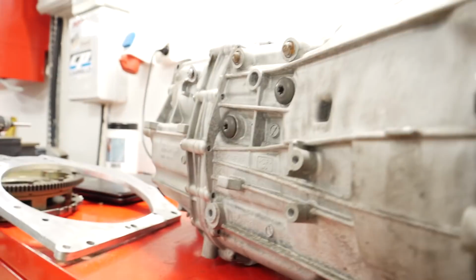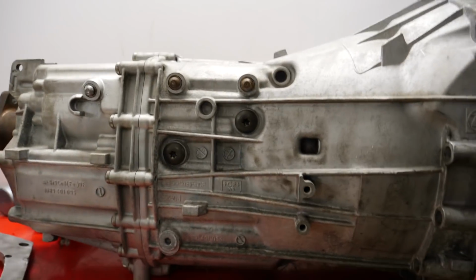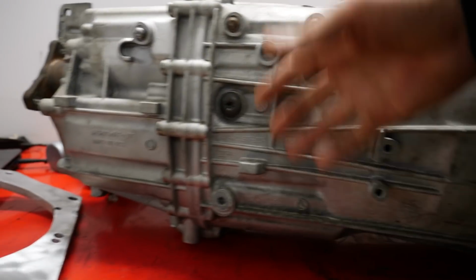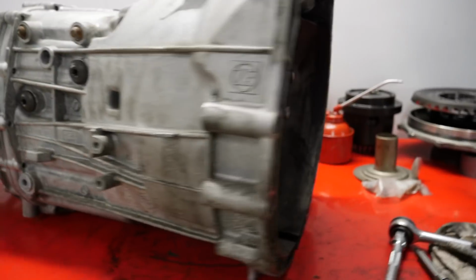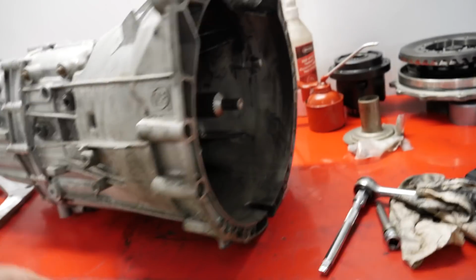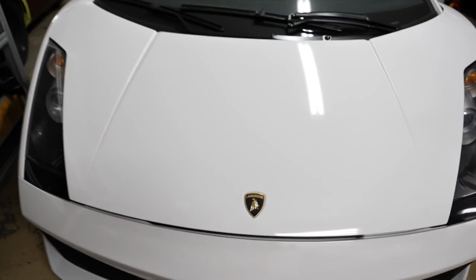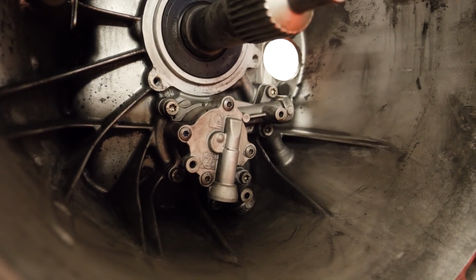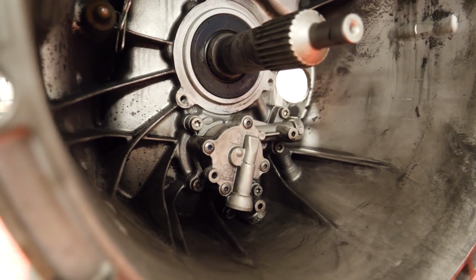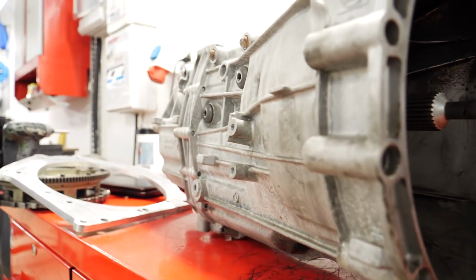Most gearboxes have oil inside them that the gears slosh around in and lubricates the gearbox. But in racing for many years they had a separate oil tank and oil pump. If the gears have to travel in so much oil, it's power losses. So it's better to have an oil pump that pumps the oil and sprays oil where it should be. The Lamborghini has an oil pump originally, and of course racing gearboxes like Formula 1 have that. And this one has a little oil pump. I'm not sure how much oil it has in this one now and exactly how it's working, but this is one thing they made to make these gearboxes a little bit more efficient.